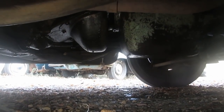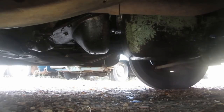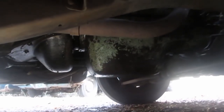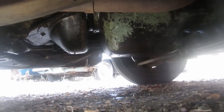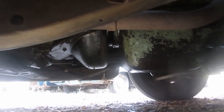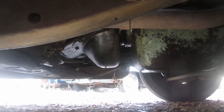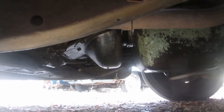You can see that one drop of antifreeze on the bottom of the bell housing has been sitting there just like that for 5 minutes. So it's actually dripped more oil since I've gotten back than it has antifreeze. Considering it dripped out about 10 liters overnight and now is not dripping at all, I'm going to call that a success. And the freezer will live to fight another day.